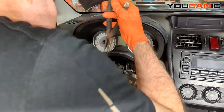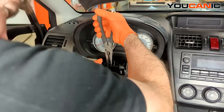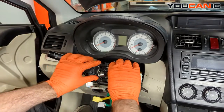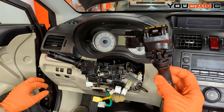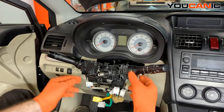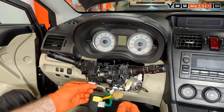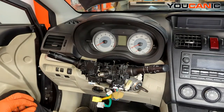If it's not working, just open it a bit, get it to line down, and lock the clamp back into place. It has little channels and grooves that line into there. Then we put this portion of it back on, which just slides into place. Make the electric connections, and that is the install and replacement of your combination switch.